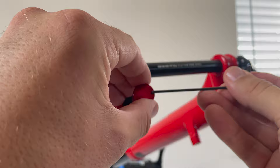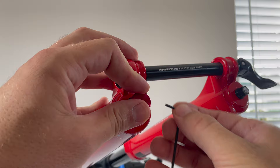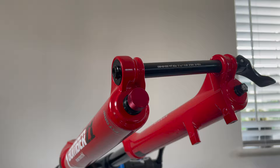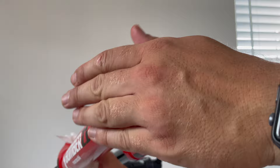With the foot nuts fully home and torqued down we can reinstall the damper adjuster. This uses a 2mm hex key - just don't do it up super tight, it just needs to be locked down against the flat of the adjuster on the damper rod. With that fully installed we can install the rebound knob cover to make sure it's protected and won't fall off and disappear. Wipe down the fork to make sure there's no excess oil that could trap dirt and we're pretty much done.